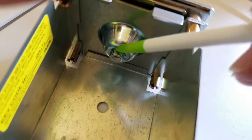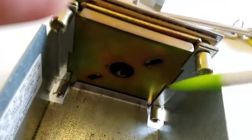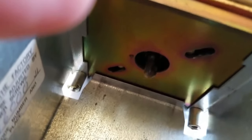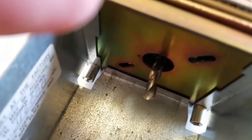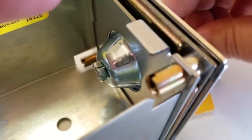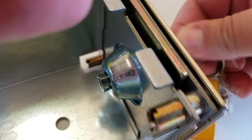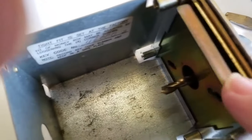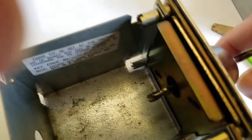What they have in here is a nut. When you get to a certain point with your drill bit, the nut is just going to pop out — the nut and the little stud will just pop into the box. Another thing you need to remember is you've got to open this cam. This is how they open — when you turn the lock, it opens that cam, and you have the little side piece that comes out and locks into here. On one of the boxes I just happened to luck out — in drilling, I unlocked the cam, and that worked out fine.